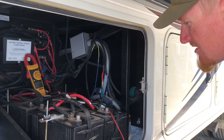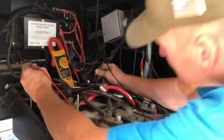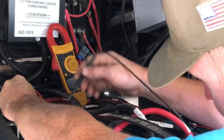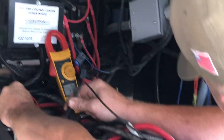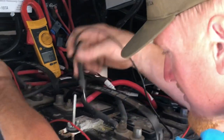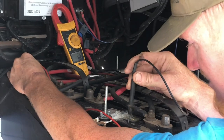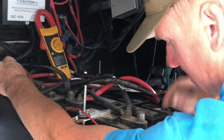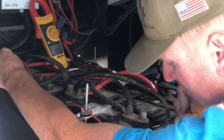These batteries are draining out on me. If I check voltage from one side to another I get 11.8. If I just check one battery it is 11.8. But if I check from the positive to right here on the battery on the plastic where it's wet, I get 7.6. And I check right here, I get 10.6.